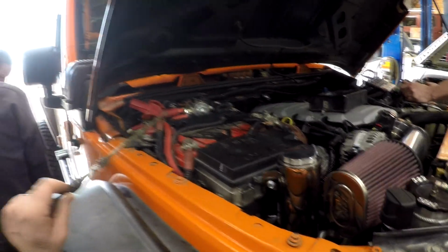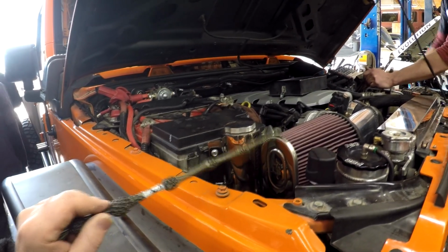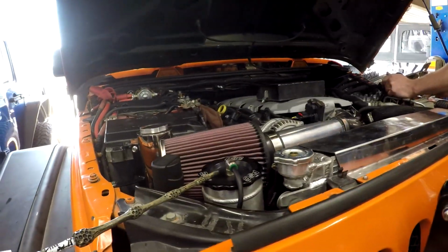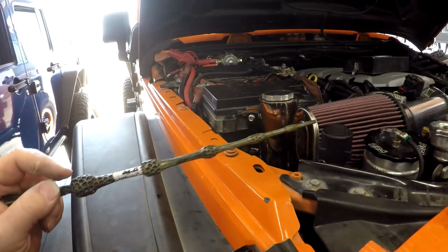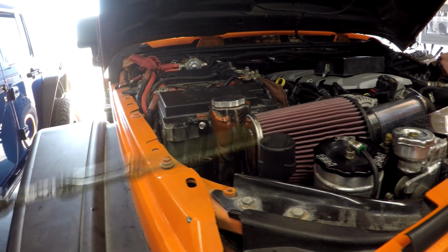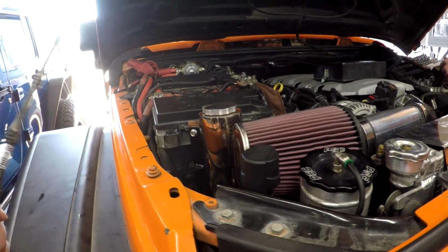And you notice that he's got dual batteries. Looks like he's got the Genesis tray. Here's our coolant overflow bottle. We are running a K&N filter in this. We can also run the Spectre. We've got our PSC reservoir because we got hydraulics, and this is what they call their anti-splash valve, which is really nothing more than a pressure valve that holds a few psi to keep the fluid from aerating and puking out here, which is something that I think they've needed for a long time.